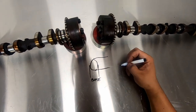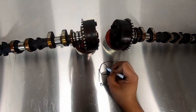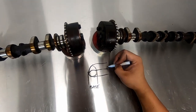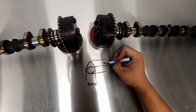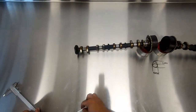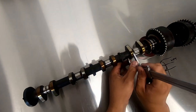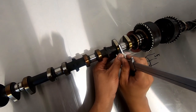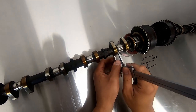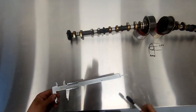The result of longer intake duration is to increase valve overlap — where both intake and exhaust valves are open at the same time to aid in scavenging, which in turn reduces emissions. Given that both of these engines are early builds, i.e. pre-2006, I didn't bother measuring duration since there was only one specification. The camshaft lift on the other hand is a different story, with many different measurements being thrown around, so I decided to measure it myself.